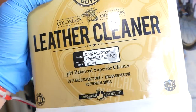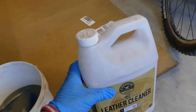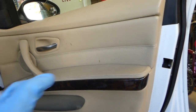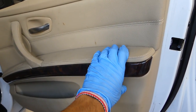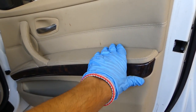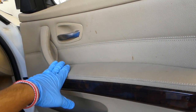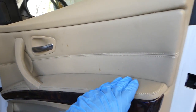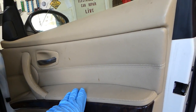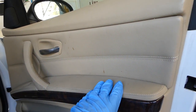The first thing we'll be using is Leather Cleaner PH Balance by Chemical Guys. All the materials we'll use will be listed in the description below. Most of the panel is leather, that's why we'll be using leather cleaner. It's very important to use PH Balance because most BMW plastic is covered with a thin layer of rubber, and that rubber will start peeling off if you do not use a PH-balanced product. One more thing you need to do towards the end to prevent that rubber from peeling off — stay with us.